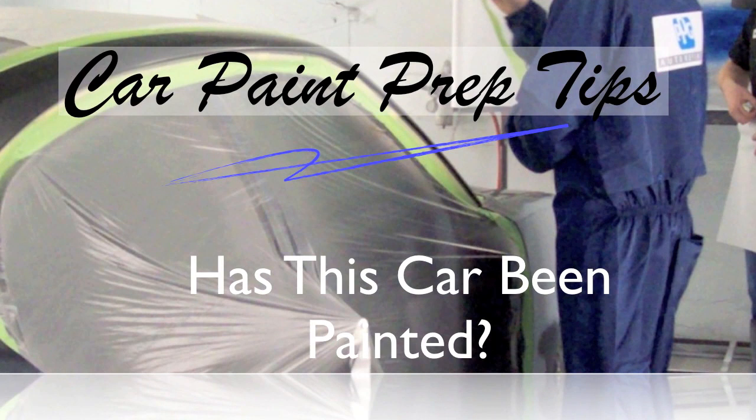Has this car been painted? One of the easiest indications is by the way it was masked. You don't have to be a trained professional to see this — if you see a jam with a really hard edge, or moldings with overspray or primer on them, anybody can see that. You may think masking is not that important in the overall picture, but this is something you want to do really well. After the car is painted, the objective is to make an invisible repair — you cannot tell the car has been painted. So take your time when masking.